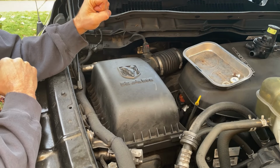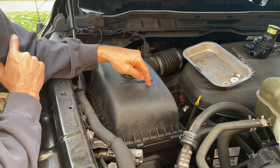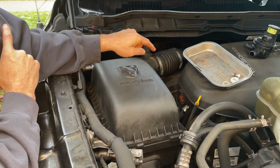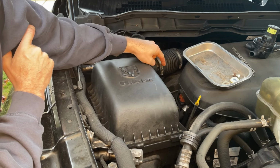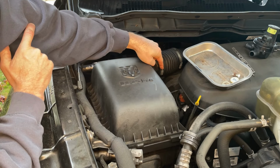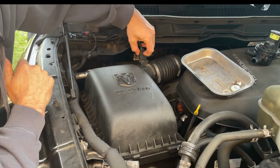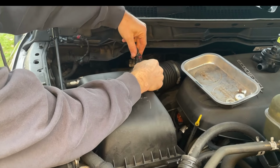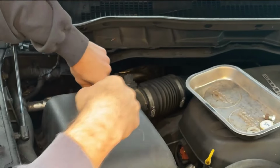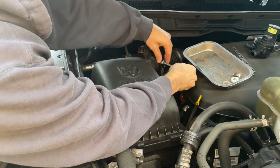Okay, so the valve is under the air box here. So the easiest way to do it is to start by removing this air box. To remove this, we've got to disconnect this connector here and this 8mm nut on the hose, and take that off. So we'll do that first. You just lift this up, and once you pull this up, push down the tab, and then wiggle that off. Off comes that connector, and then our 8mm socket.